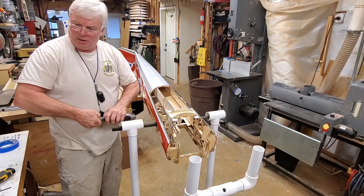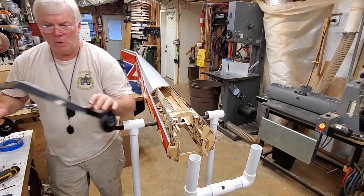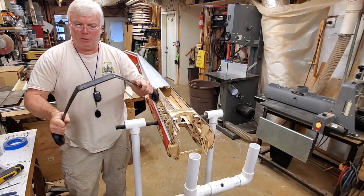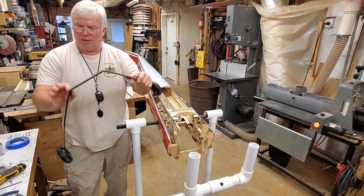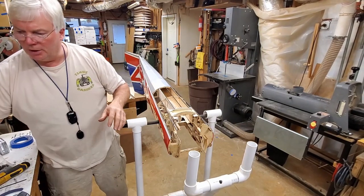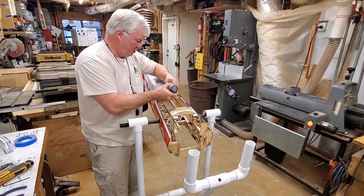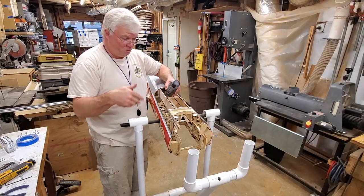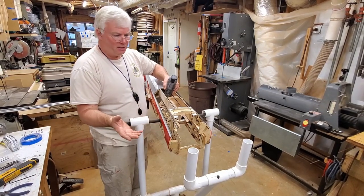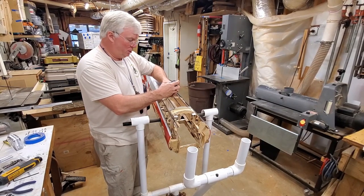I was very fortunate that the landing gear didn't get destroyed in this case, which is rare. Usually, if you look at the carbon fiber landing gear hard, it wants to delaminate up here in the corners, but this one never touched the ground since it darted straight in on the nose. It was running a DA60, and of course, I sent that in. Although the DA turned over well, whenever one goes in hard like that, it's always a good idea to send it to DA and let them go through it. It's worth the trouble in the long run.